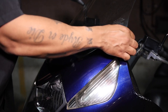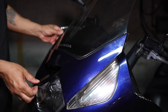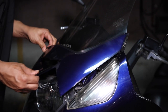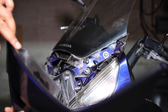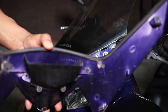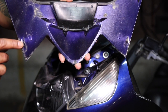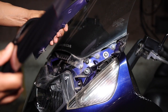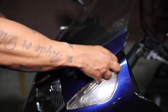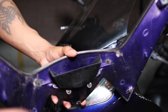What you want to do now is pull these wings out a little bit, make sure you clear, and wiggle the whole assembly down. Then you'll be able to remove the front cowl. What makes this difficult is the vent that allows air into the driver's cabin, and there are some hooks on the side of the cowl as well. So again, lift the wings out of the way, spread them, wiggle the whole unit down, and it should come off. Two screws here, two screws here — that's it.